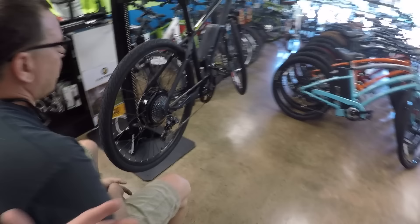You've got the rotors and the brake pads. Are they meant to squeak to let you know you need new pads, like in cars? Not really — if you get all the way down to metal on metal, yes, but I rarely ever see that. Most people come in and we point it out before it reaches that point. The brake pads last pretty long on bicycles — I have bikes that have gone 4,000 miles and are still on the original brake pads from the manufacturer.